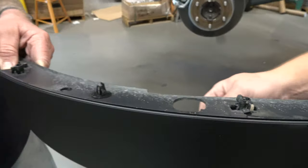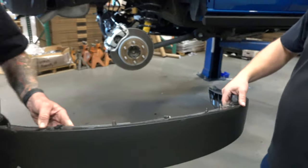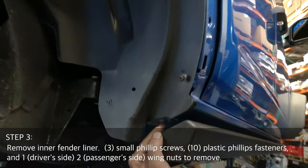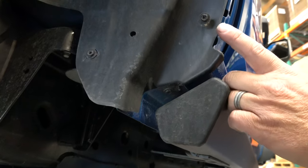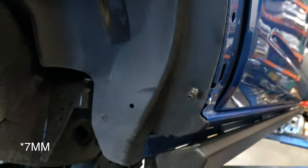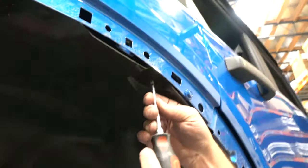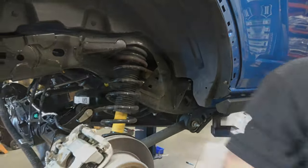It's harder the first time — the first time pulling it off is a little stickier because these are brand new clips. For screw locations: there's one here that you can't get a screwdriver on, so you have to use a small 6-millimeter wrench because you can't reach it. All three are in the corner. The rest of them are plastic clips, which you can loosen with a Phillips, but if you push too hard they'll just strip. So you have to do it lightly with a smaller Phillips.